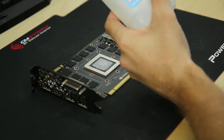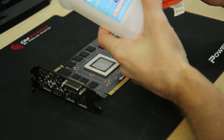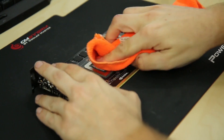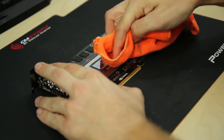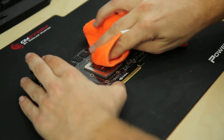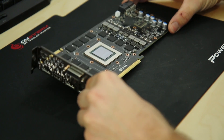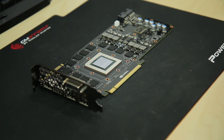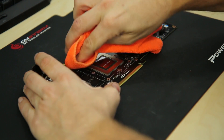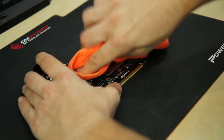I forgot to mention you're going to need some rubbing alcohol as well as a microfiber cloth, coffee filter, or something non-fibrous to clean off all the old thermal paste. Take some isopropyl alcohol — anything 70% or higher — and get off all of that old thermal paste. It's not critical that you get down into every little crack and trace around the GPU, but I like to do it because when you put on the new block it will inevitably get into those crevices. Also take a little alcohol to the top of each RAM chip, because residual grease from the old thermal pads will make the new thermal pads difficult to stick and could make them slip off.